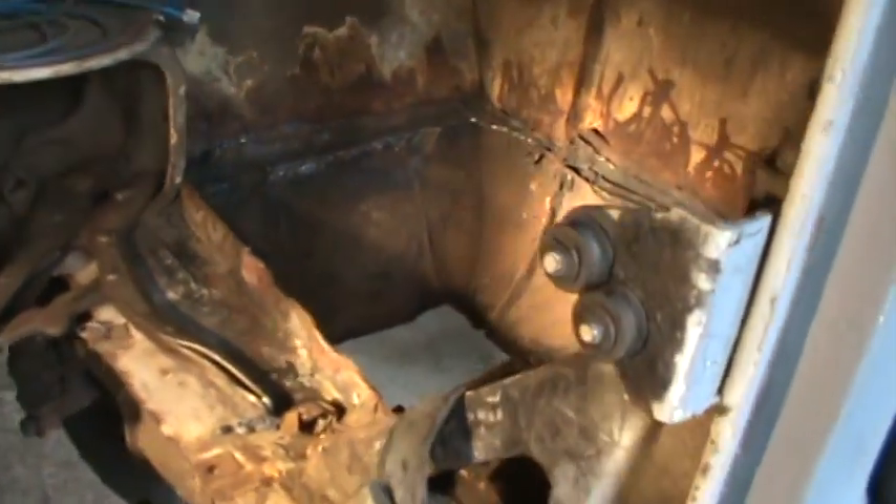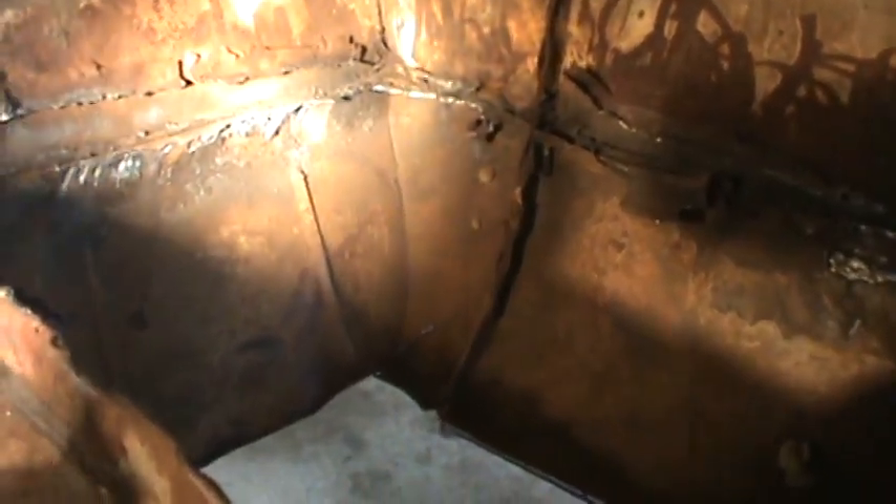It basically came out in little slivers. The thing is I'm trying to not destroy what I need to weld to, but they kind of mangled their way on there with different welds. You can see that glob of a weld right there. That goes around on the first level, and the lower level should have spot welds all around it. What I think I'm going to do — I'm not going to be too concerned with removing every last bit of the lip. I'll just leave that lower lip behind and grind it flat to the wall. I'll have the lip go upward where it went downward before — and clean back to something I can work with.